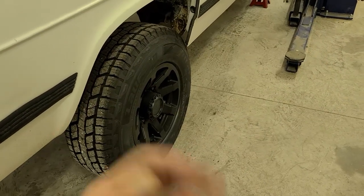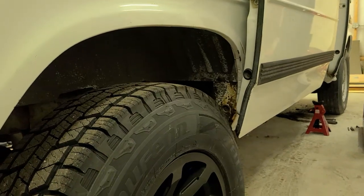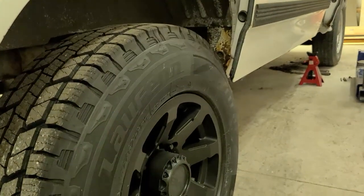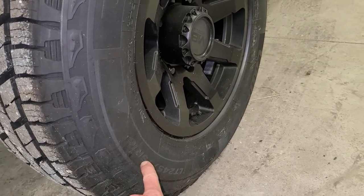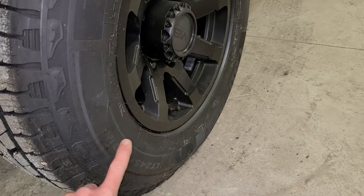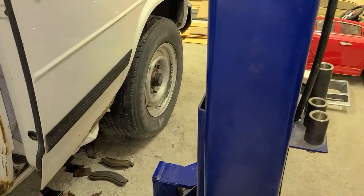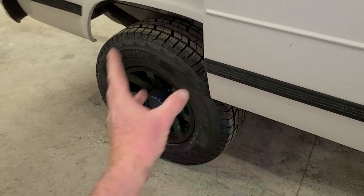The question I get asked — and was asking myself — about the G30 and G20 vans: the G30 has a beefier suspension, so you can fit some nice tires underneath. These are the same size as stock except they're wider and better looking. The tire size on this is 245-75R16 — once again, 245-75R16. A 16-inch rim has to fit around your back drum brakes on your G30. Compare those stock ones to these — they just look like a 4x4 off-roader.